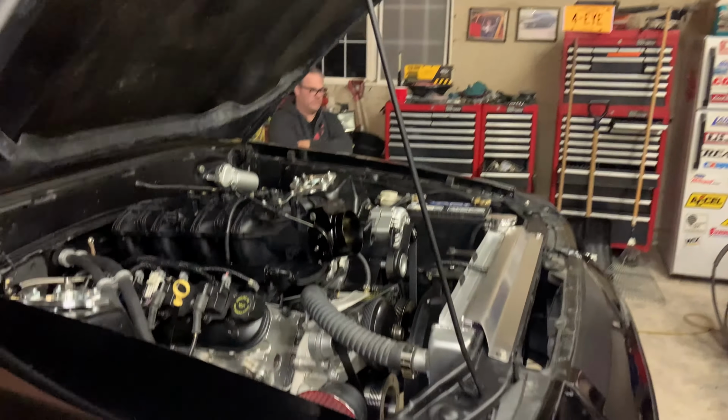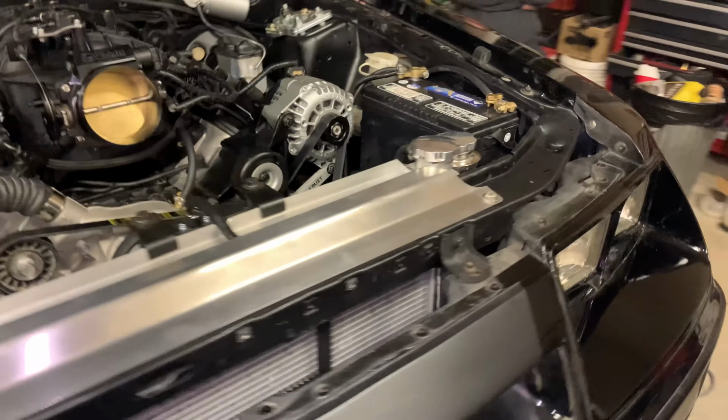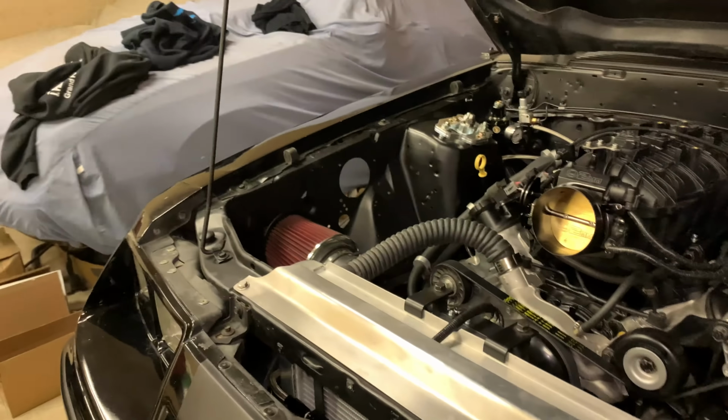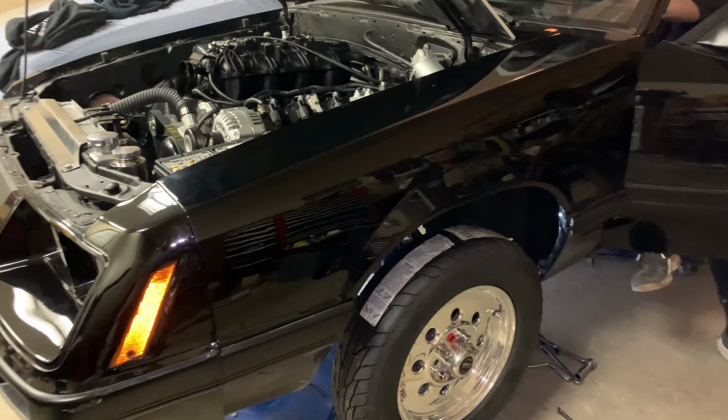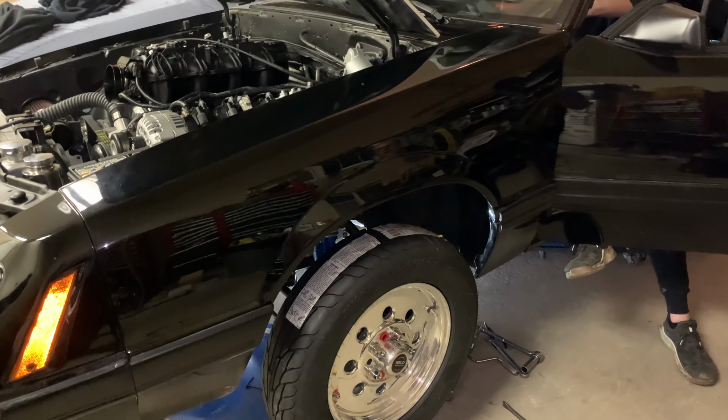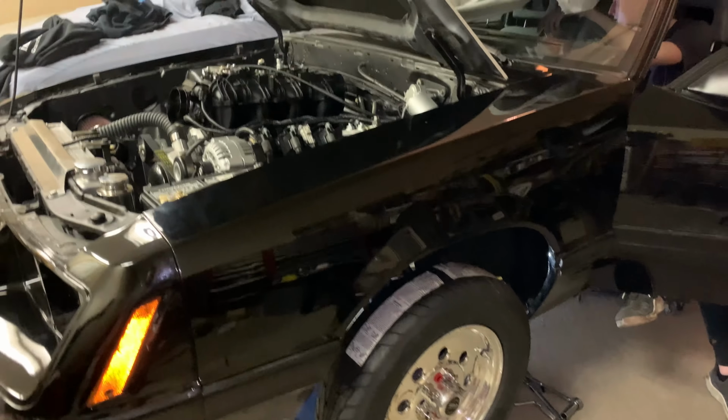You know, Mom's nervous. Crack that door open, I guess, again. Just watch for oil pressure. It might take a few seconds, four or five seconds, you should see something. It should start going up. I'll watch for leaks. And if it decides to rev up or something, get ready to shut the key off.